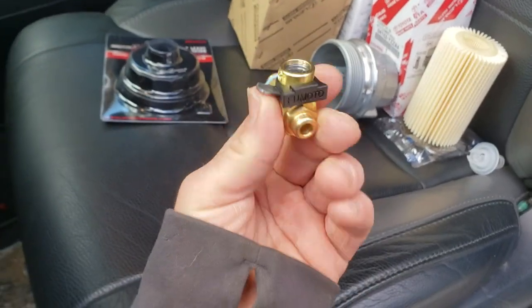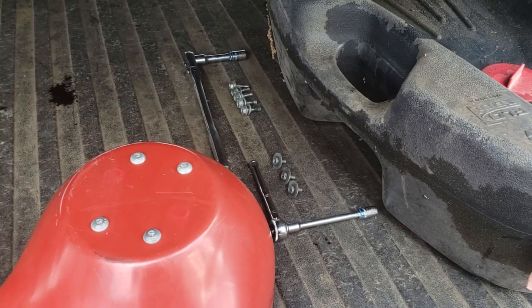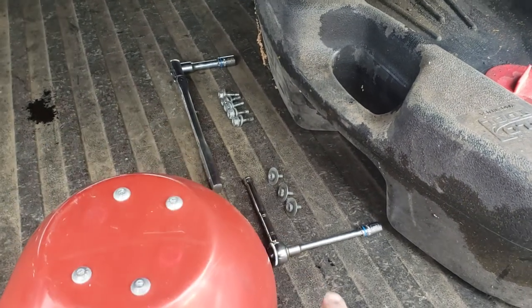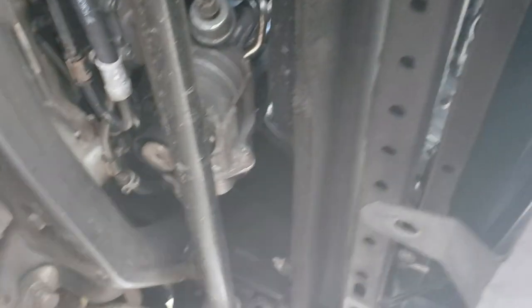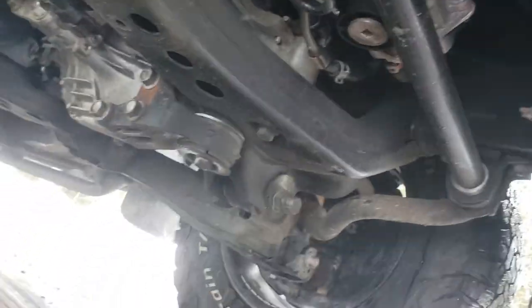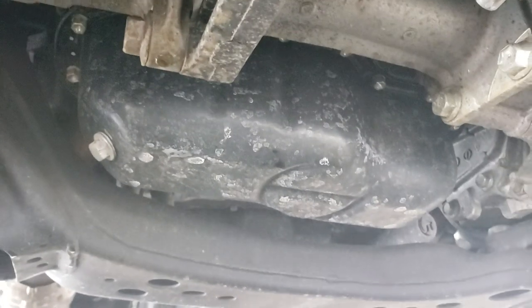It's pretty solid — I've looked it over quite a bit. Alright, let's get started. There are five bolts holding on the skid plate and then three bolts with a Phillips screw head. You have to undo all of them, and then you will actually shift the skid plate over and it'll drop down.